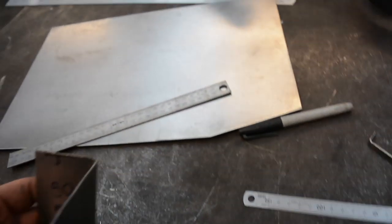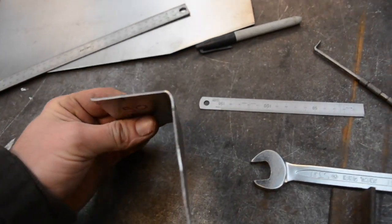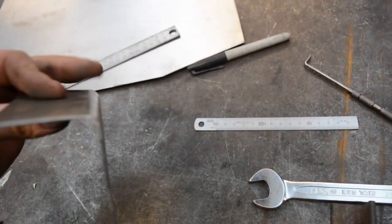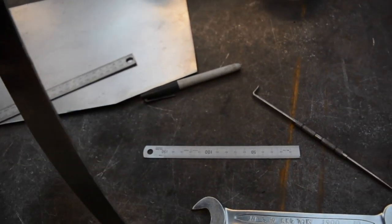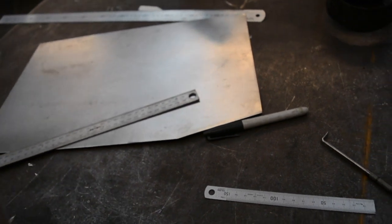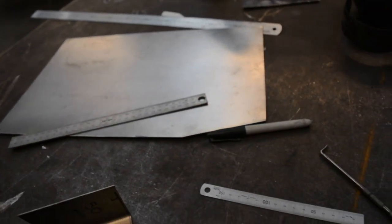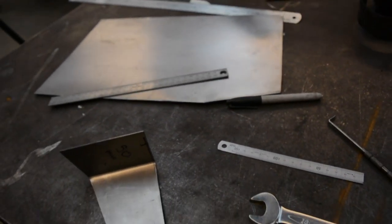So when I fold this up, with two angles, I need to take away the 4 mil on this fold and the 4 mil on the other fold. So from the width I want, which is 115, I'll take away 8 mil, and that'll give me my two fold lines, and then once I fold them, I'll get back to exactly where I wanted.